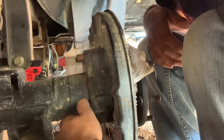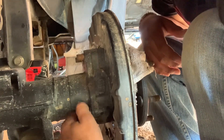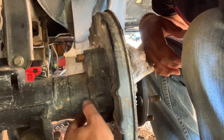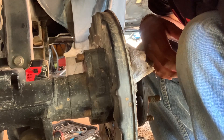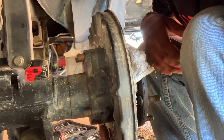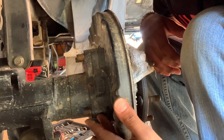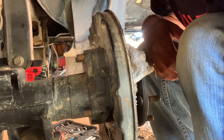That's the final 17 millimeter nut — that's four of them now. We'll get a catch can and place it underneath the axle tube right here, so when it separates from the hub assembly, if it leaks any fluid it'll fall into the catch can and not all over the floor on my feet.